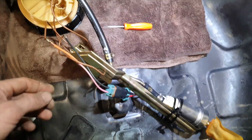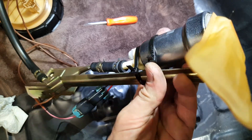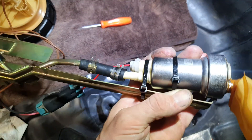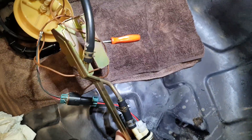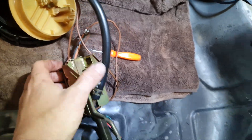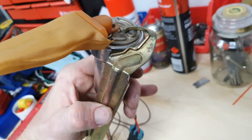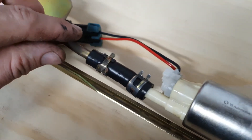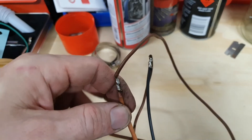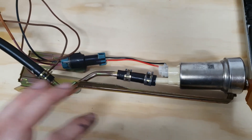Look at these zip ties - I don't want to pay out on the person too much, but I'm used to high standards of work. The fuel pump wasn't even clicked in properly - it's come loose off the bracket by the looks of it, that's all bent. One of the clamps has slipped off, there's way too much wiring than what's actually needed, and the main cause was the heat shrink slipping off - these two wires were touching together, which is enough to short any fused circuit.